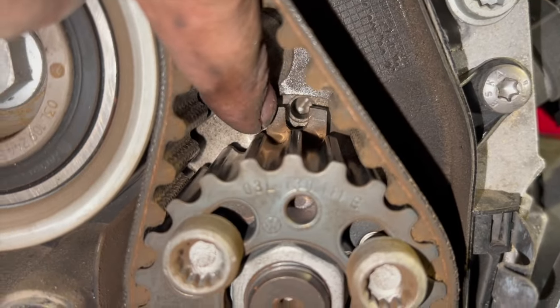Alright, so that's the belt on there. You can see it wasn't actually too bad to do. Again, because these pulleys are cracked off, normally you need to keep it really taut around this side, but because you can set that pulley to there, it doesn't really matter, it makes it a lot easier because you can put the belt on. Same with the crankshaft. And then when it's on, let's just tweak it round, taut it, tension it up on this side. And that's the idea of slackening them off. When you put the tension on, it pulls the belt, the tension nice and even all the way around there.